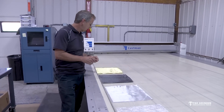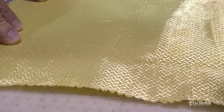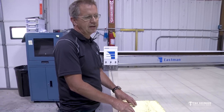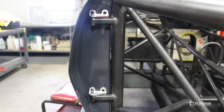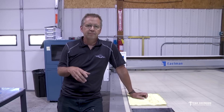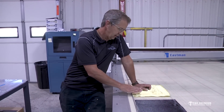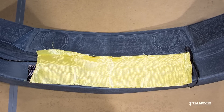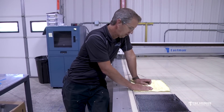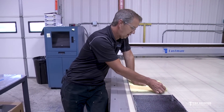This is an aramid fiber. It does not come in the carbon fiber repair kit because it's hard to work with. It's called an aramid fiber and it's similar to what's used in a bulletproof vest or any structure where you need really high strength. We use this material in a lot of our components — in a body around the wheel openings, door hinge area, door striker area, the back edge of the quarter panel where the door meets it, around the rear wheel opening, and around the wheelie bar opening, because it can take stress and is very tough. It's very hard to cut and withstands impacts well. An aramid fiber combined with carbon fiber cloth is a very strong composite layup. This stuff has to be compressed under vacuum when you're laminating with it.